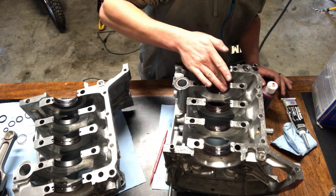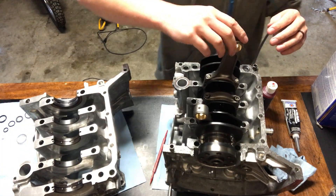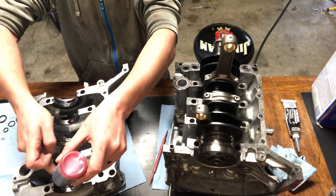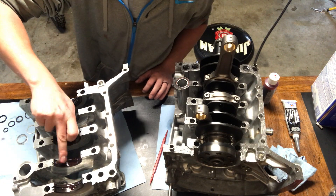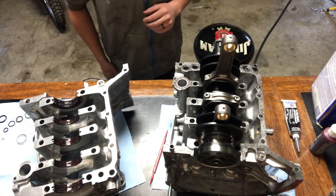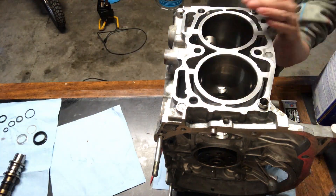So we'll put some silicone on it, greasing up the main bearings and installing the crankshaft. The crankshaft has the connecting rods already on them and then we'll go ahead and grease up the other bearings. So we have oil going all the way around the crankshaft. It's important to grease the sides of the thrust bearings as well. This is overlooked on a lot of builds and it will cause problems. Once you get everything greased, set, and siliconed, it's time to install.